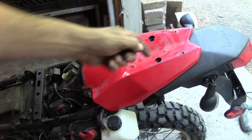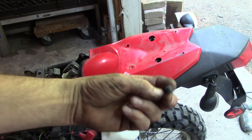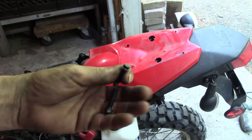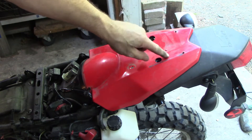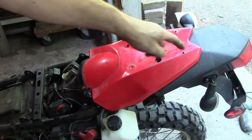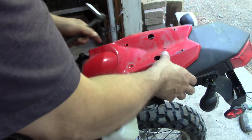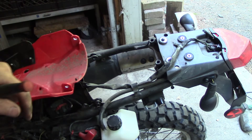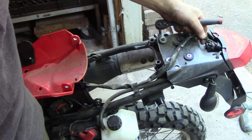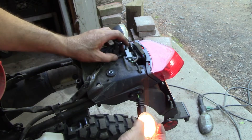These two are stainless ones. There are holes here that aren't supposed to be there - those are from my rack. Right underneath here there's these bolts using the same socket, and they're black. There's two sets of black ones and a cross member underneath with heads that look like this - I believe those are welded on. Then there's two more here and you might have to wipe some mud or dirt off to find them, but they're under there. At this point this thing should come off.